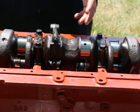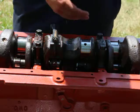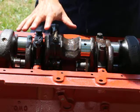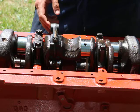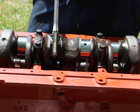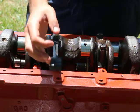Ideally you want to try this with all connecting rods. You put them on the crankshaft just to test the size of the bearings. If I were to put a bearing that's too small, it would feel loose; a bearing that's too big would be too stiff. You're supposed to move it very freely — just with its own weight. That's how it's supposed to be: not too loose, not too tight, but no movement up and down or sideways.